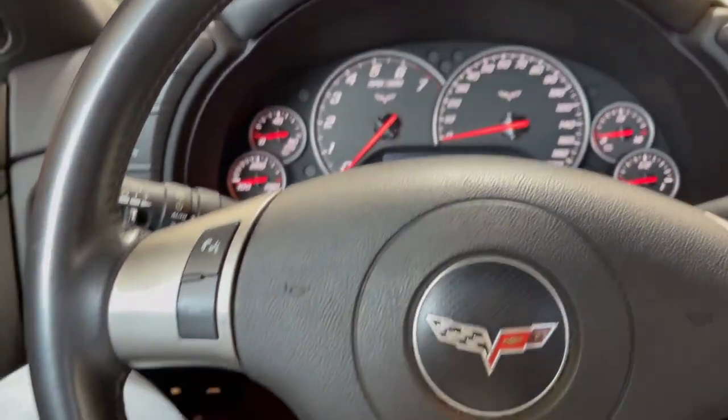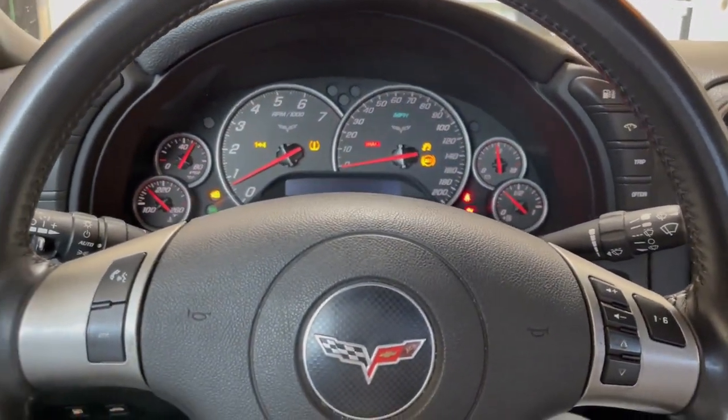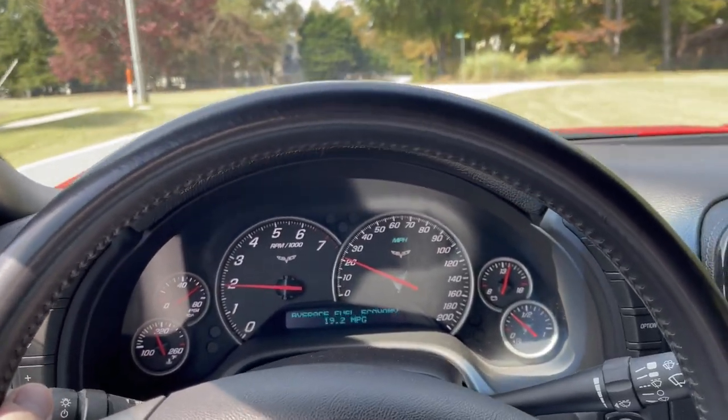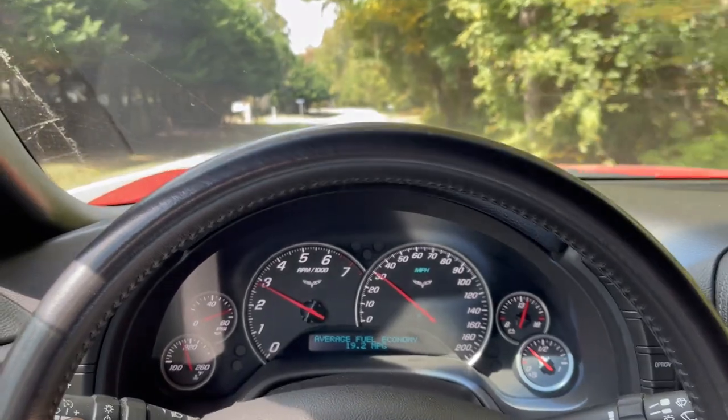Now the thing is to drive it. It's not completely gone but it's a lot better. Going back and forth, tweaking the car a little bit, it's not making any noises. If I hit some bigger bumps or go around a corner it creaked a little bit, but not bad. That weather stripping is really dry so it might take a couple of applications to get it much better, but for now it's good. Let me know if you guys do anything different to fix a noisy top. I have links in the description to the two products I used today. I've got more to come for this Corvette — thanks for watching!